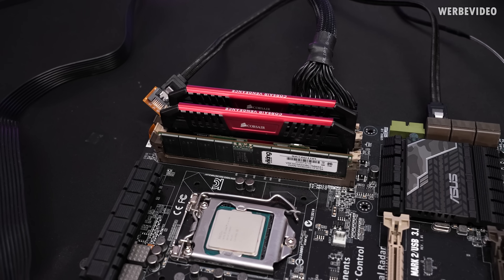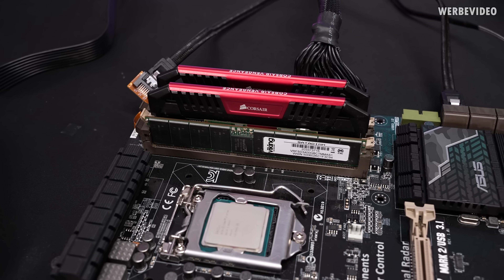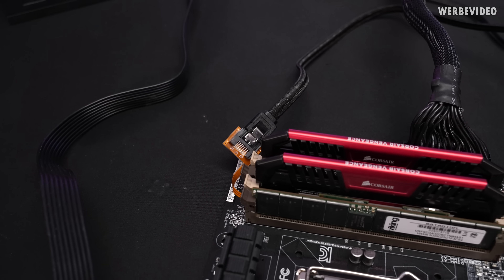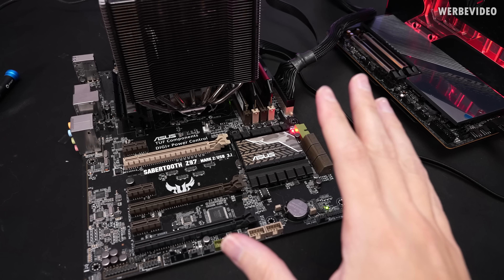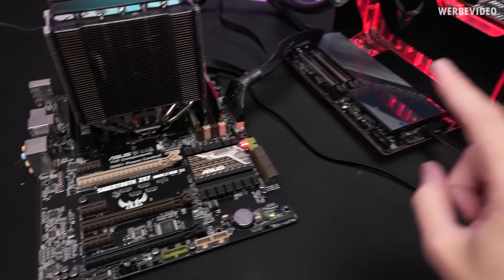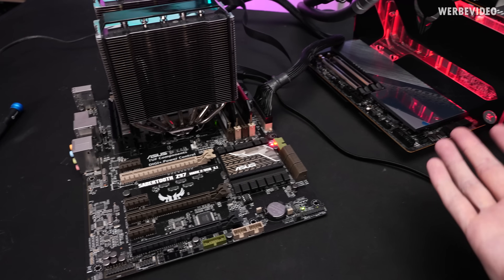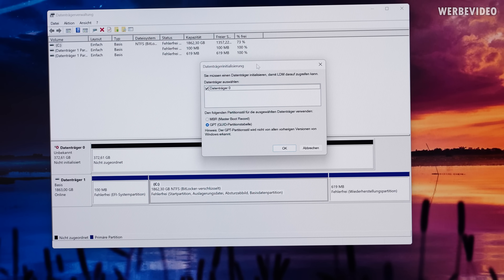This is how it could have looked like: you have your primary two DIMMs and then in front — or in a sandwich configuration — you would use the SATADIMM. Plug in your SATA cable and route it back to your mainboard. I've plugged this into my donor system and connected it to the primary one, and now I want to find out: can we first detect it, and if yes, can we run some benchmarks? That looks pretty promising.